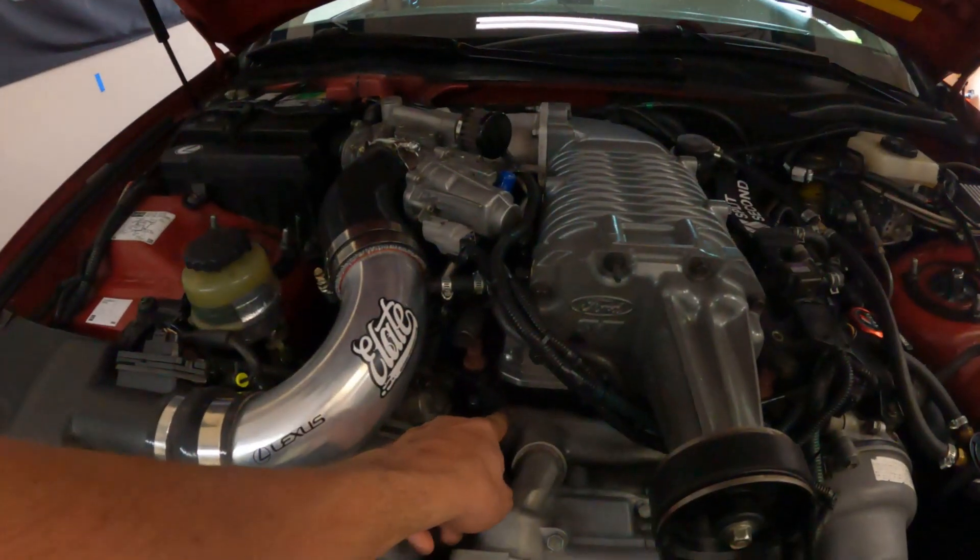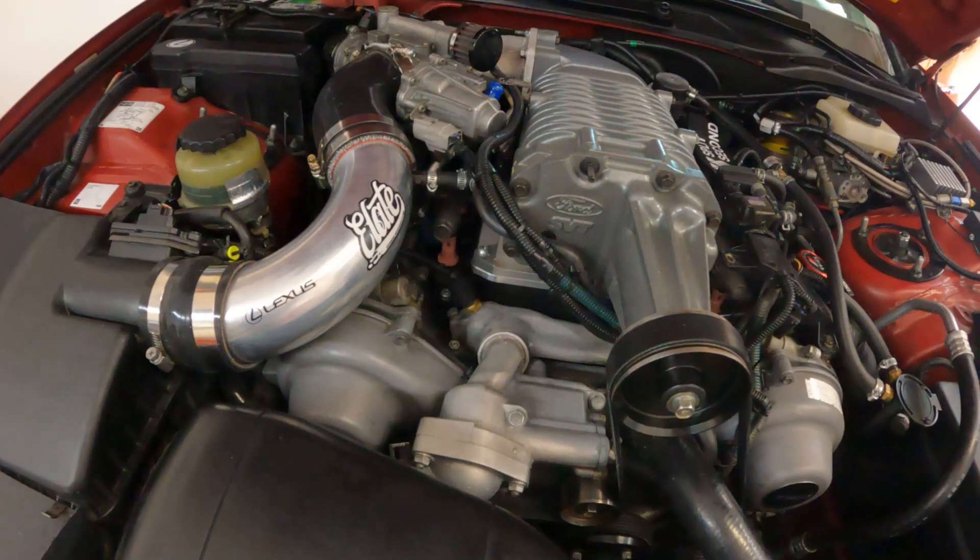There's $85 down the tube, but hey — I have a new crank position sensor. You've got to check for fuel, air, and spark, then check all the sensors and wiring in between. It can be tedious and stressful, but just remember it could be as simple as your engine coolant temperature sensor right there.